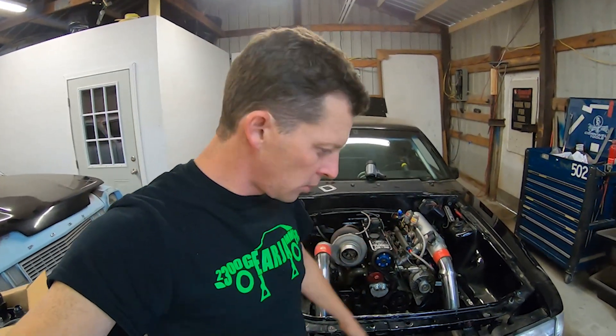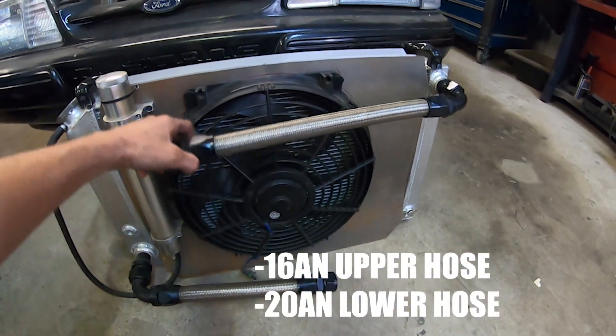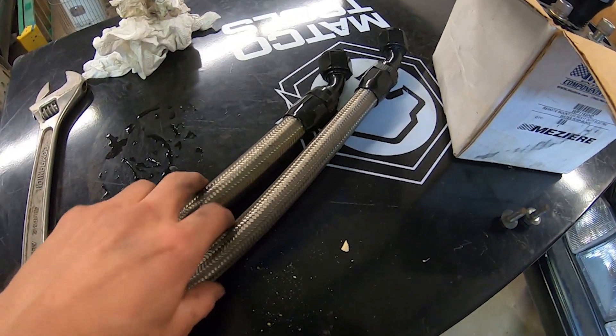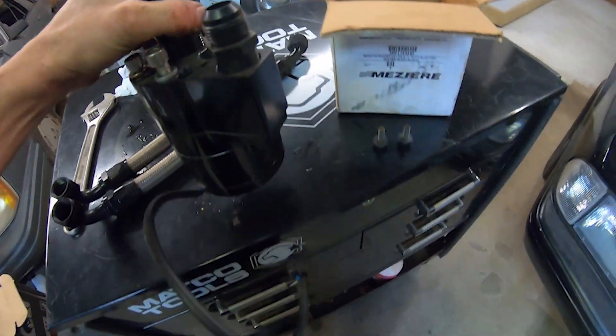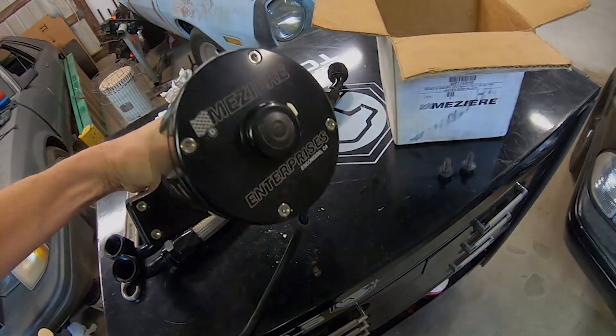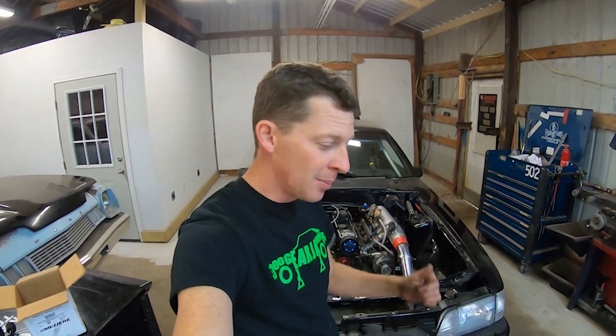Next I want to fill this huge hole here. The cooling system is pretty much the same as what I said in the Pinto video — it's a drop-in unit. Fox radiator, cheap fan. We're going to do a dash-16 upper, dash-20 lower. The hoses from the water pump up to the water pump housing are 16s, and the water pump is a brand new Meziere WP116S. When I did the cooling system in 2010, not one piece of it was new — not one fitting, nothing. I didn't have money to spend on a $130 lower radiator hose, so I went on eBay over and over and bought a few fittings at a time until I had enough pieces. Now this would be the first time it's all brand new, so it'll probably break part numbers.